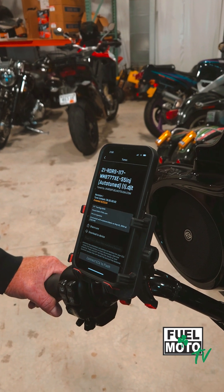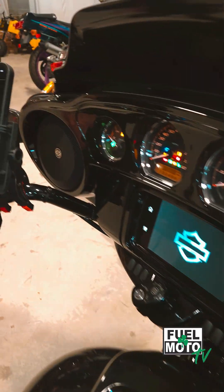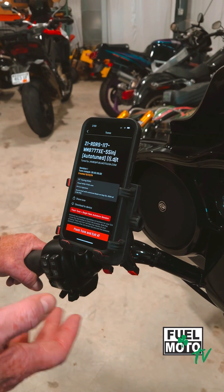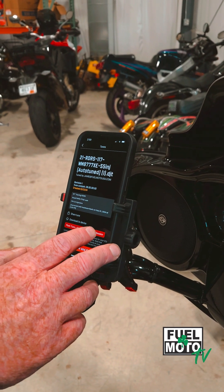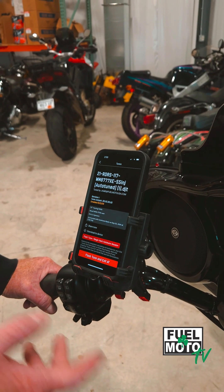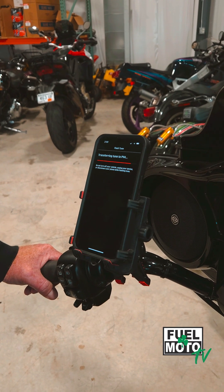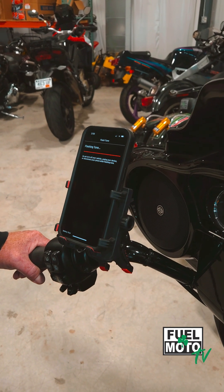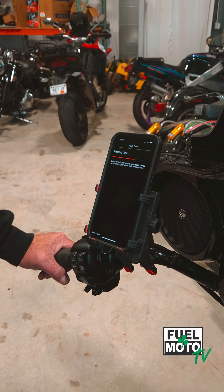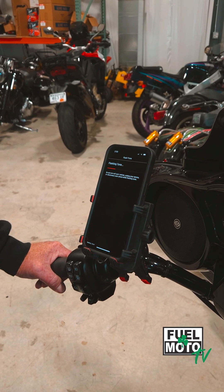If you want to flash it, turn your ignition and run switch on. As you can see, it says AutoTune 1. Now we're going to flash tune and exit. If you want to flash the tune and begin the next AutoTune session, there's a quick way to do that too — just flash the tune and begin your next session. In this case we'll flash the tune and exit, then select yes. It takes 30 seconds to a minute depending on your vehicle, and it's going to flash back into your ECU as the finished tune. Once it's done flashing, you'll be ready to ride. Two to three 20-minute sessions will generally get you where you want. Stay tuned for the next video where we go into some of the more advanced settings.